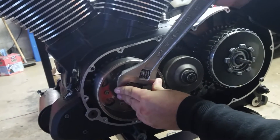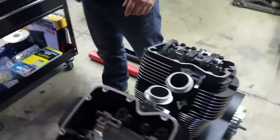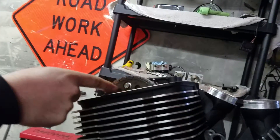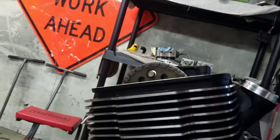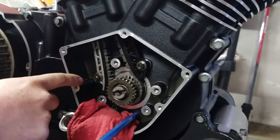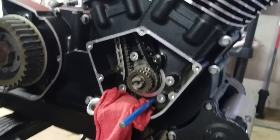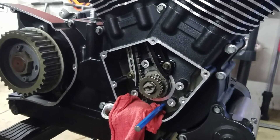Just to recap before you start doing this — make sure you're on time. You'll see here we're still up top, we have our two hash marks aligned with the top of the head. Make sure you torque this to 120 inch-pounds, and these to 100 inch-pounds. You can also apply moly or oil into any of these if you want — it's not going to hurt anything, but it's not required.